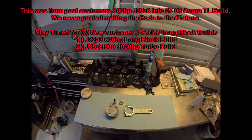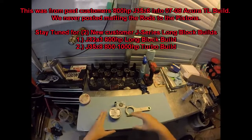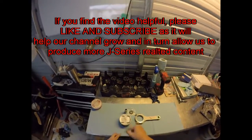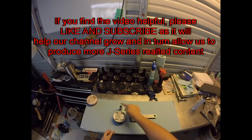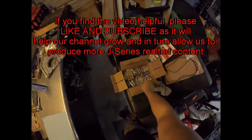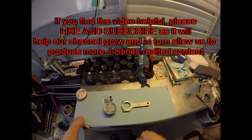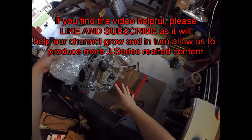Welcome back to Hafferland Performance. We're doing a hands-on video today because I need my hands to show you how to mate all of our parts together — our Hafferland 800-plus horsepower J32/J35 pistons, which come with oversized thicker wrist pins at plus one millimeter, and C-clips are included. We have our full kit here, and we're mating them to our J35 1300-horsepower Hafferland rods.